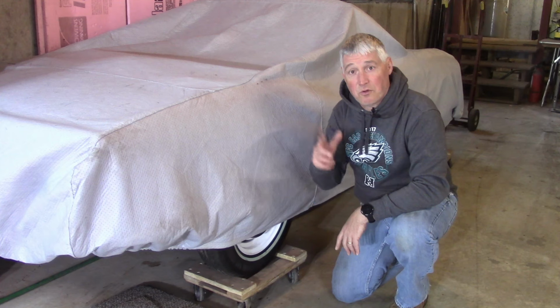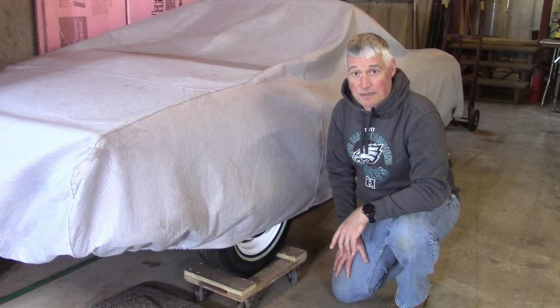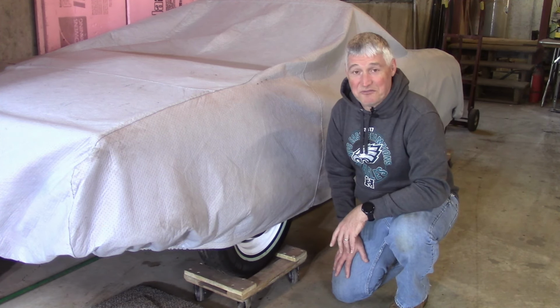So I'll get the car out, roll it to the back, get the thing uncovered, obviously get it started up, do a once over, and warm it up so I can get the oil out of here. It's 20W50, and it's only about 45 degrees in the garage right now. That stuff will pour like mud, so I need to get it warmed up to get the oil drained.